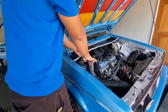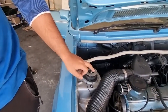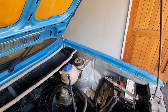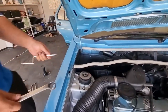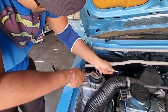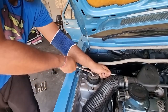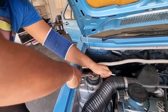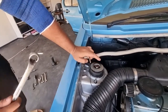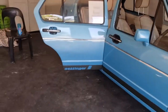The first thing we'll be doing is spraying these three bolts here - one, two, three - with a bit of Q20. I have done that previously on both sides. Then with your 22mm spanner and your 6mm allen key, lock it in place and loosen this top nut. Remember, don't loosen it right out - loosen it till there's a bit of thread left on the nut. We will loosen it fully once you remove the shock and spring.